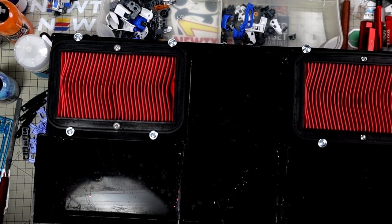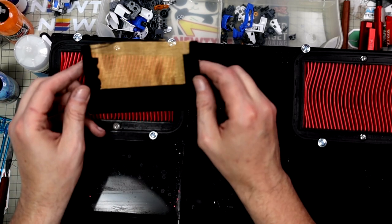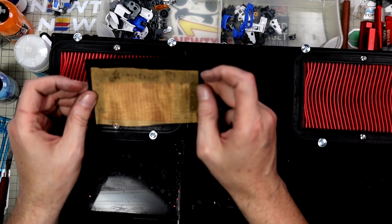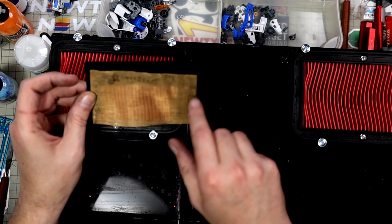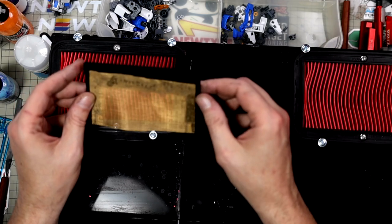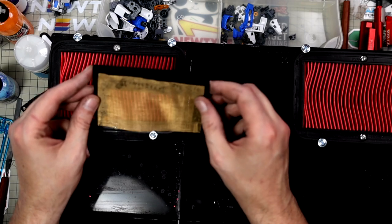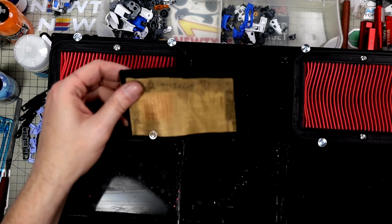This is a little advice to Kaizo. So this plate and a lot of the other plates, you put a plastic coating on the front and the backside. The problem with that is it started peeling off of the backside of this where there were the silicone gaskets. And when it peeled off, they went with it. So I would recommend peeling those off and then putting on the silicone gaskets. Otherwise, they just turn into trash. So that would be a suggestion with that. I will show you this here in a second.